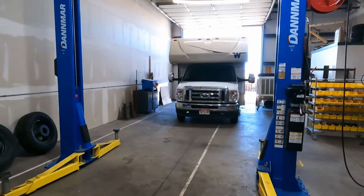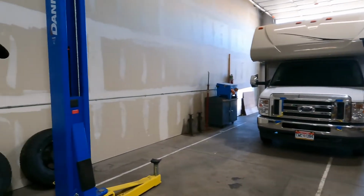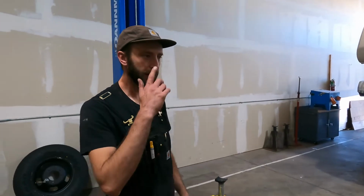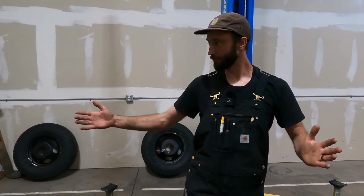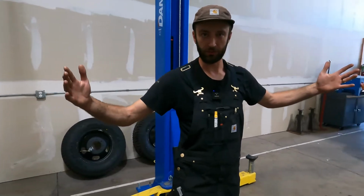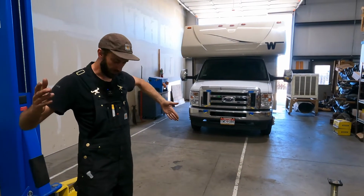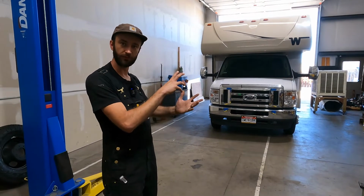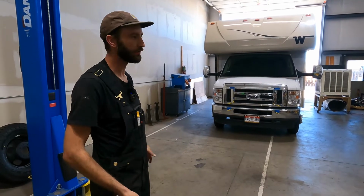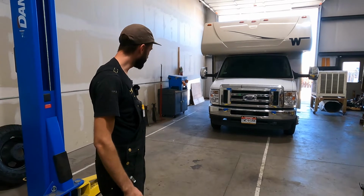Yep. So we're in the middle of the vehicle now, working our way to the back. So what, rear drive shaft? Yep, so rear drive shaft, we're going to use the majority of your factory drive shaft. Obviously the whole powertrain gets longer by the length of the transfer case. So we need to slice off a little bit of the factory rear drive shaft, and then we're going to weld the correct flange onto the front of it. And then obviously Drive Shaft Shop is doing all of this for us. It'll be completely rebalanced, recoded, and then it'll go back in.